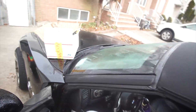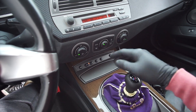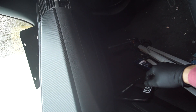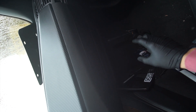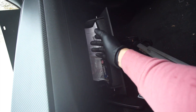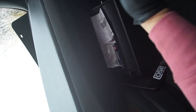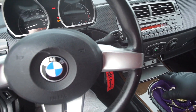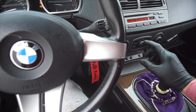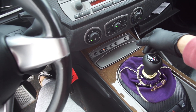After that, none of the lights were working - I think it created a short and blew my fuse. After replacing the fuse - the fuse panel on the BMW Z4 is located right under the glove box. There are two buttons, and once you trigger those the little cover pops down and you'll find the fuse panel right behind it. For the convertible I believe it was fuse number 12 that was blown, and after replacing that all the lights came back.